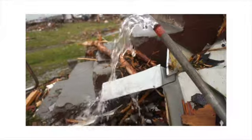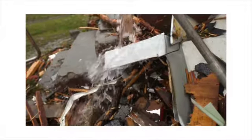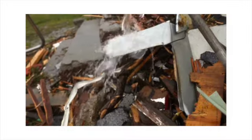In the future, I definitely do. It's really common for RVs, campers, and trailers to get water damage. A little bit of a leak can really seep into the bones of the structure. There are different ways to attend to that — there are actually wood hardeners that are made for water-damaged wood. As long as the frame is still strong, then you're good to go.